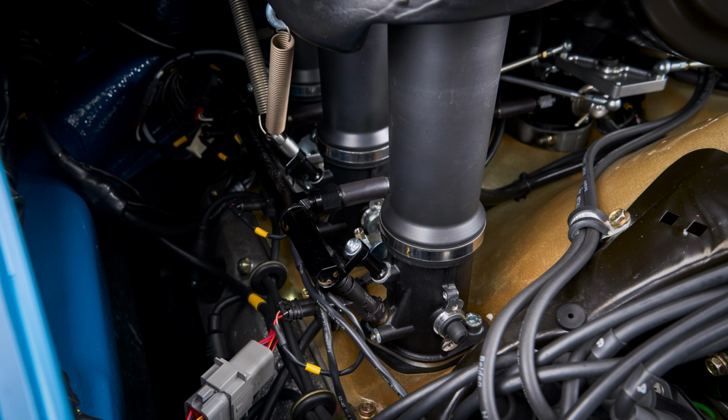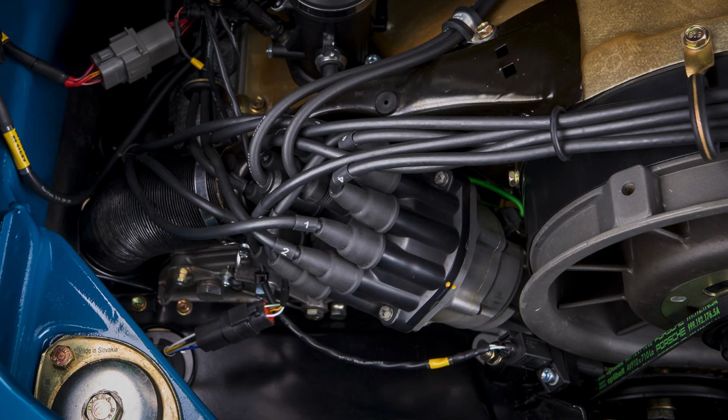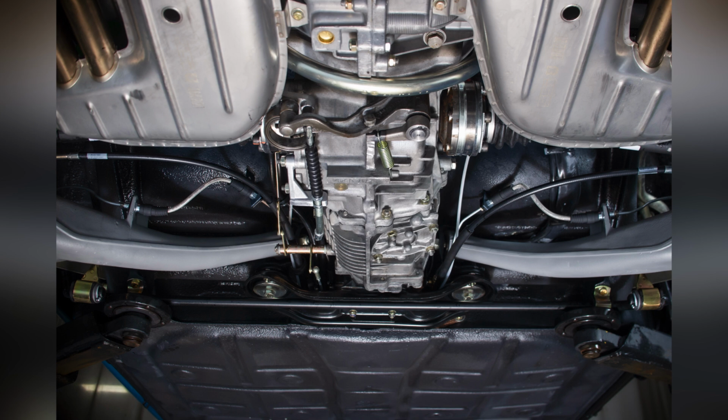Engine, like I said, 3.2 short stroke. What makes it a short stroke, obviously, is you go to 98 millimeter bigger pistons and cylinders. These are JEs, but you use the 70.4 millimeter stock 3-liter crank. This is a JB distributor, twin plug distributor, very expensive. The engine dynoed at 255 horsepower, I believe.